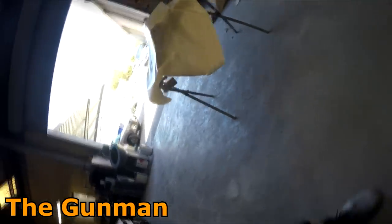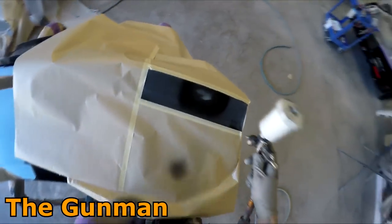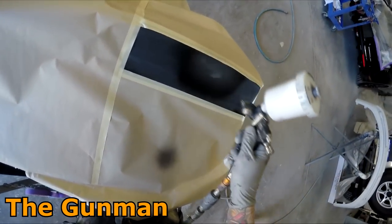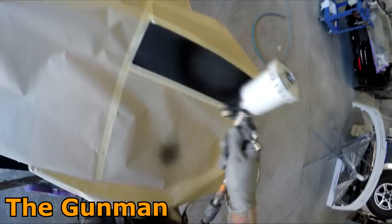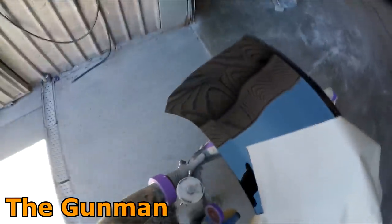You wouldn't go and start replacing all your sort of prime up jobs of a night with it, but for something like this, when you're prepping your car to go into the booth and you just need to use a minimal amount of it on a small repair, well, then it's absolutely ideal, especially when we're using the solvent-based base coats, which can be prone to shrinking back. If you're using water-based, you may even just be able to get away with using a bit of 1K primer or something like that, and then put some wet on wet non-sanding primer over the top of it, and that would be enough. But yeah, at this point I'm really enjoying using this UV cured primer.